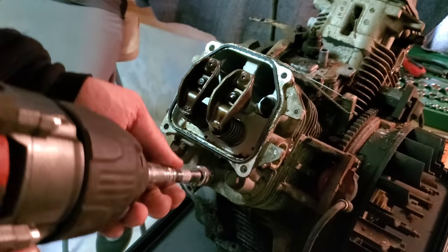So we've got a ground here. We've got a positive right here on the starter solenoid. We've got our punch button right there. We've got our punch button to the positive. So we're gonna stand back and see if this thing will actually try to act up. Whoa. Well, that tried to move. Let's clip this on again. That was quite the little kick. All right. Let's give it another little kick and let's see if it'll get the oil out. There we go. Yep, right there on that curtain. And that is why our curtain is a throwaway sheet.